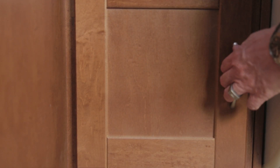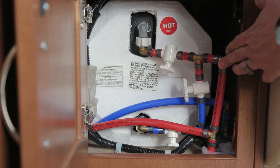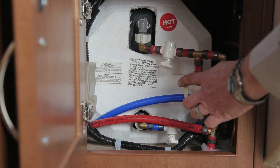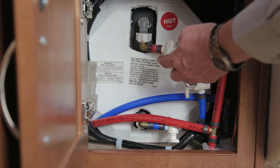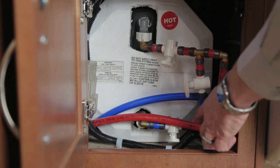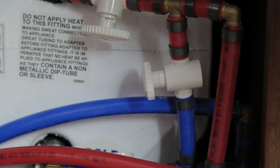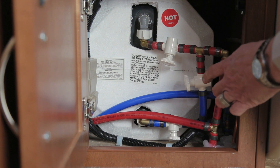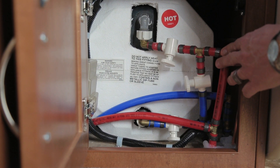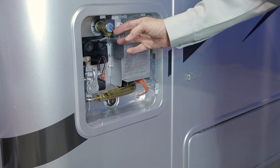On the driver's side in the lower door just behind the driver's seat, you will find your water heater bypass valves. The water heater is currently set for winter mode, bypassing the water heater — you will notice three bypass valves. When the handle is in line with the water line, the valve is open; when it makes a T with the water line, the valve is closed. For summer mode, open your top valve and bottom valve with handles in line with the water line, and close the bypass valve in between by making a T. These are 90-degree valves. If you leave the center valve open, you will have a mixture of hot and cold water and your water will likely end up hand-wash warm. Please ensure your water heater is full of water before turning on the water heater switch — check using the pressure release valve on the outside.